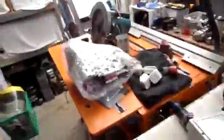Okay, well, there's the case largely stripped down. I've got the old board out and everything, which we'll have a look at in a minute. I'm also going to take the front cover off and get the micro switches out of this so I can put my new ones in. Oh yeah, and if you're wondering what this is, it's an anti-static strap. I highly recommend you wear one if you work with computers that you don't want to destroy. I'm only messing around with junk machines off the roadside, but I still want them to work, so always wear one if you're working on a really expensive machine.